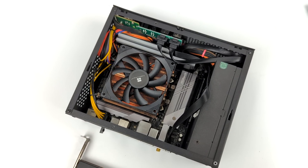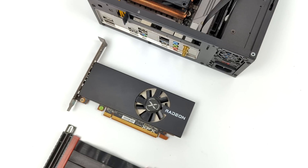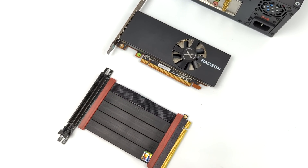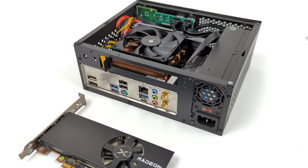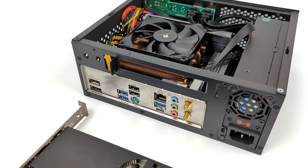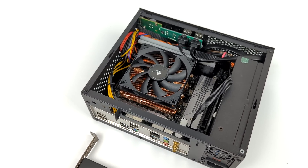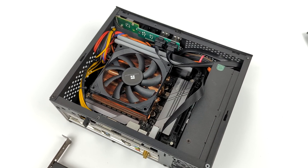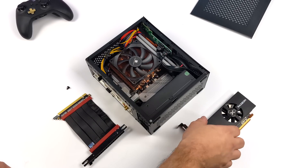Now it's time to tackle the GPU. We're going to be using the Radeon RX 6400 — a low profile single slot card, this is the XFX model. Other manufacturers do make these single slot low profile cards as well. With this case you can see it's going to sit in here a bit funky. The 6400 uses PCIe 4.0, and I've seen up to around a 16% decrease in performance when running this card in a 3.0 slot. But this board does have a PCIe 4.0 slot, and with a riser cable it is possible to mount it here.